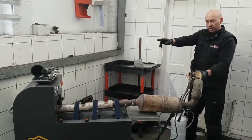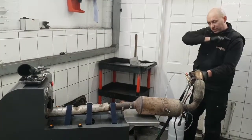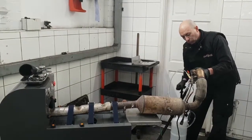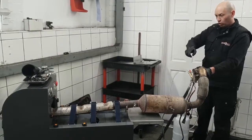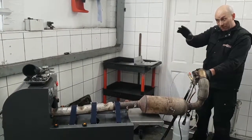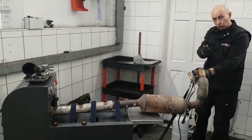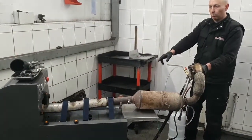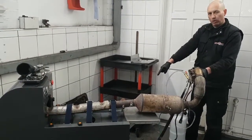What's happening at the moment — we're on a timer there which forces air at regular intervals. You can see that there's water coming out of here, but we're also trying to force it through the DPF. At the minute we're getting very little through, which is how blocked it is, which is why this end is jerky. We have a bucket on the other side of the drain, and when it starts to flow through, all the mud will end up in that bucket.